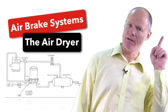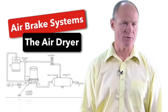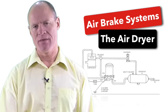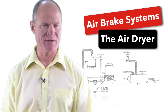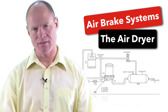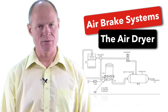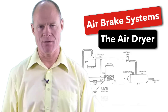The air dryer is the first indicator that the air brake system is at maximum pressure, but it is not the only indicator — for some driving tests you can't use the air dryer purging as the sole indicator. When the system is at maximum pressure, you must check the gauges and ensure they are in fact between 100 and 135 pounds per square inch. On modern air brake systems, air dryers have become so efficient that they've made the wet tank redundant. However, all the manuals will tell you that you still need to drain the air tanks daily — even though there's very little moisture in them. That's the answer to the question on the test.